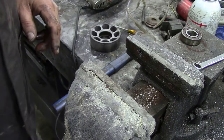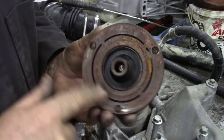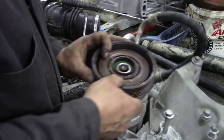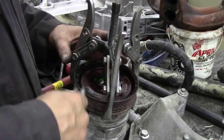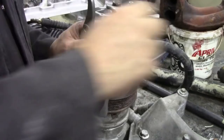Since I'm going to order online, let's also look at this air conditioning bearing and see if we can get that out too. With the center nut done, you simply pull up this plate — we're going to clean that piece up as well, sand that down. Then we get access to a fast circlip, a very strange one. I'm not sure if it lifts off or pulls off. I have a puller for these, so let me get that circlip off first. I put some penetrating oil on and used a three-legged puller — what a dream, no effort at all.